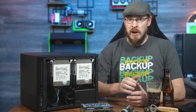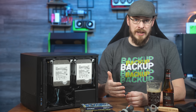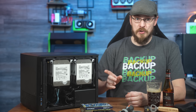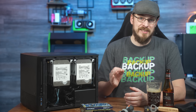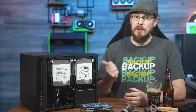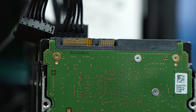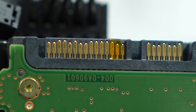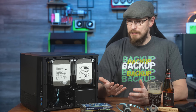One thing when using newer enterprise hard drives with consumer power supplies is the potential for the drives to not properly spin up. Pin 3 on the SATA power cable is used to trigger a reboot and park the hard drives inside of a server. Unfortunately, consumer power supplies deliver 3.3 volts constantly to that pin, so the drives won't typically spin up. To fix this, we simply need to block pin 3. My preferred way is with a bit of Kapton tape applied to the hard drive — you can actually cover the first three pins without any issue, which is what I did to all eight disks.